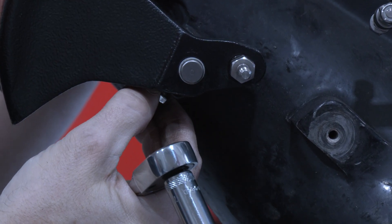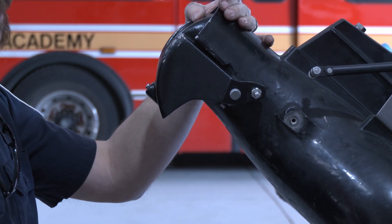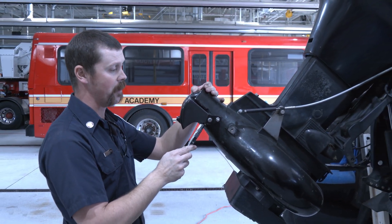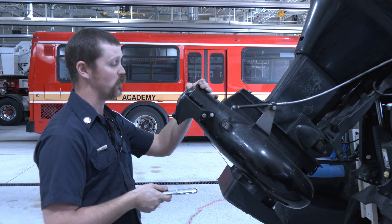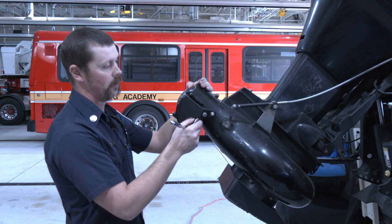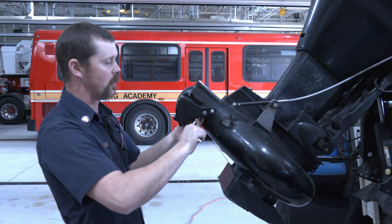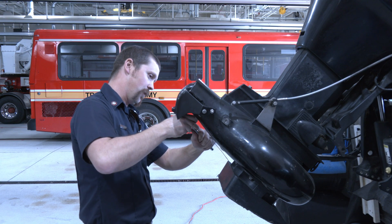This is the most important part: these bolts are stainless, which is a very hard but also very brittle metal. This is a cast aluminum housing, so you have dissimilar metals. If you overtighten these bolts they snap very easily and are a real pain to drill out — you can't use a regular drill bit because they're stainless. So just lightly snug them down. If you're putting new bolts in, they come with Loctite already applied — those are the bolts that are in the kit.